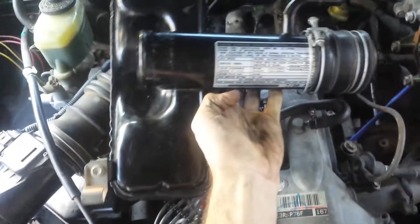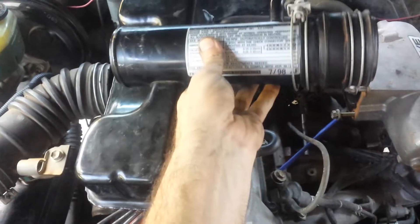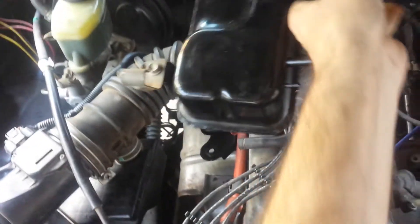To get to this you have to take your intake air connector off. Looking at the engine here, the idle air controller sits in here — the other way around — and the throttle body is on the right, with the intake manifold and airbox air connector. Getting this off was a pain — there's a bracket it sits on with two bolts underneath going into the block.